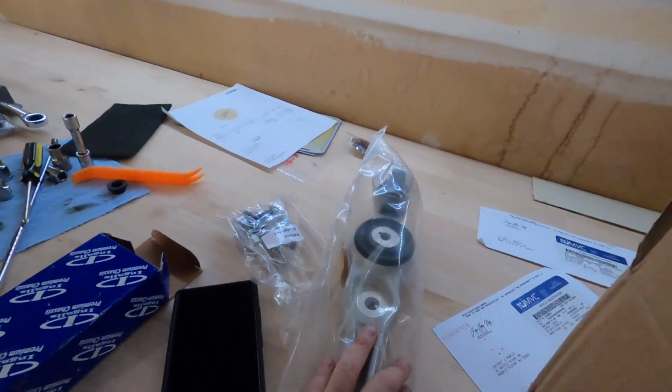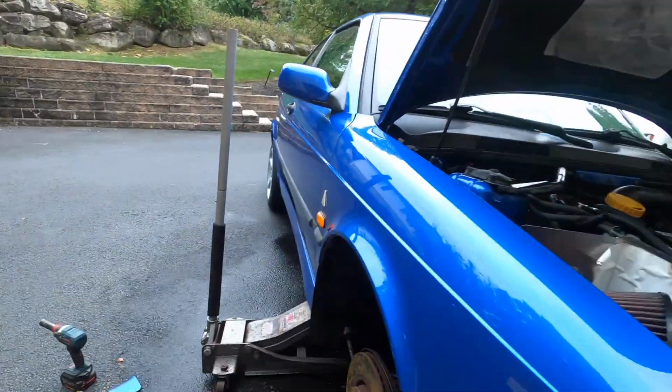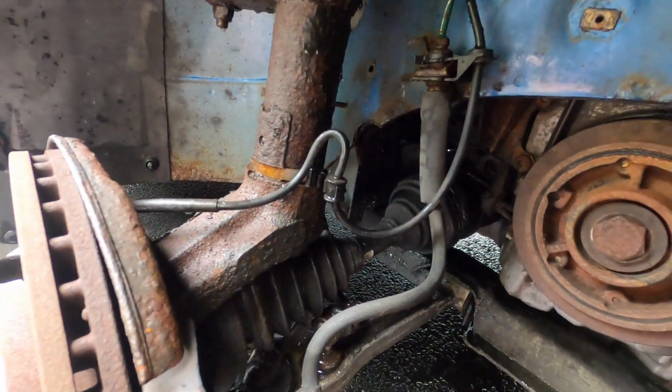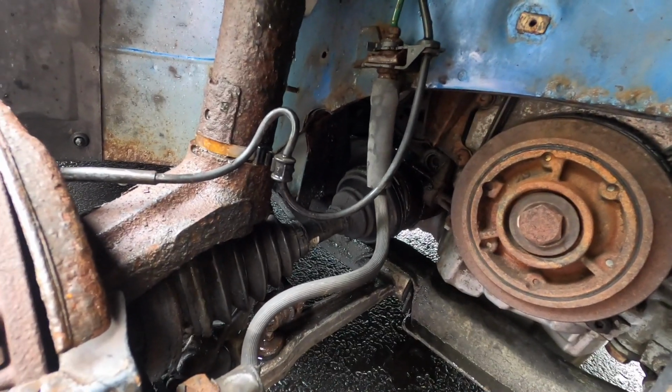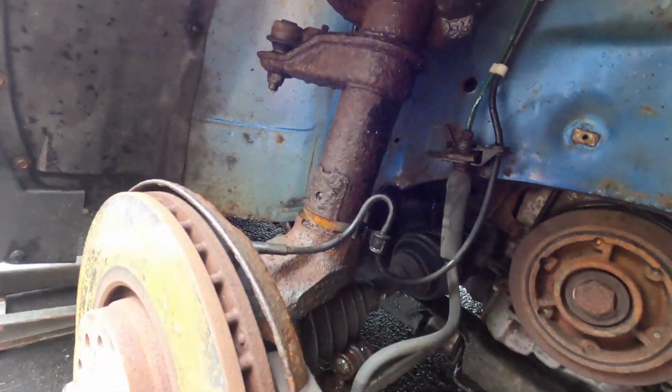We're gonna take care of the lower control arm for the passenger side, new sway bar links, and I'm still waiting for it, it didn't arrive just yet, but I'm going to be replacing the outer axle and the CV joint on the passenger side, because if you guys notice, the boots are all off, and obviously that means dirt and debris has been exposed to all of the gears in those. So I'm just gonna replace it. It wasn't that expensive to replace this outer part here, so when we have the strut out, we'll be knocking that out. So everything will be new and fresh. I mean, this car is going to be like new when we're done with it.